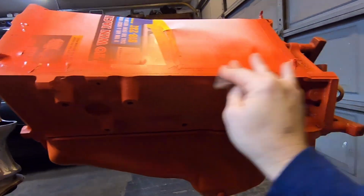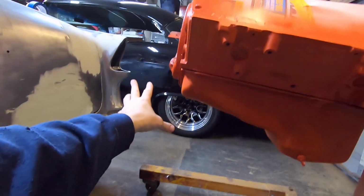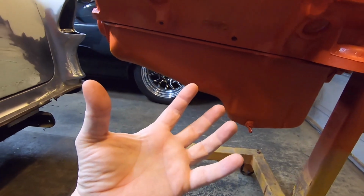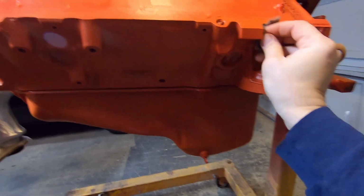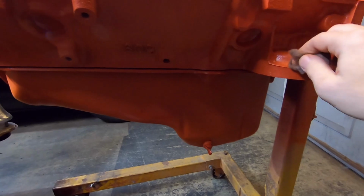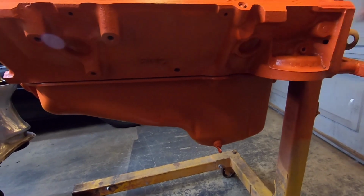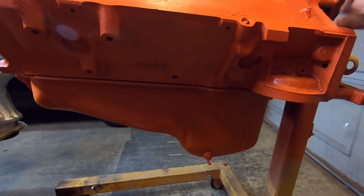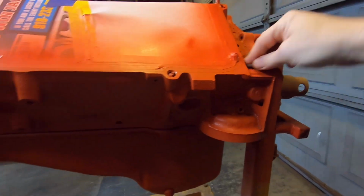But anyway, the other thing that I did not like that I did, because at the time I didn't want to buy them, is the Energy Suspension urethane body mount set that I put on that hardtop. It comes with the gold two inch OD washers. They're gold anodized for your 3/8 bolts. And I put ARP stainless 12-point bolts in the body mounts, but I used the gold anodized washer. So to me, it doesn't look right. So I went ahead and bought some 2-inch OD 3/8 ID stainless steel washers, and I'm going to swap those out one at a time under there. So it's rework basically, but it's going to finish getting it over the top is what I'm hoping.